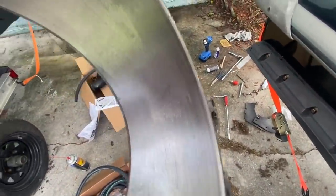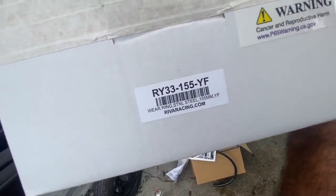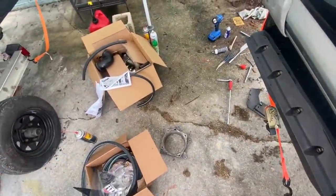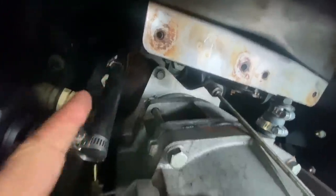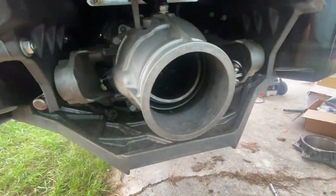So I ran down to Reva and picked up a new wear ring — this is a stainless steel wear ring, completely stainless steel, no liner, solid stainless. It won't have that problem ever again. I sealed this up, put on that strainer with the fitting, ran a line, put a bulkhead fitting there — there's the new stainless housing — and blocked off the visibility spout. Did quite a few things, we're pretty much ready to rock now.